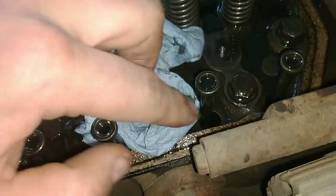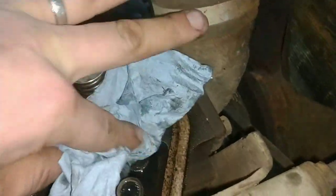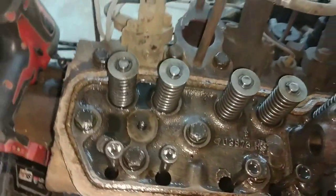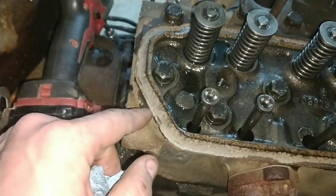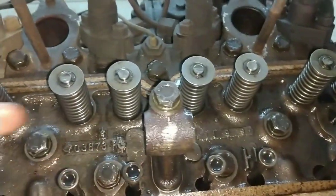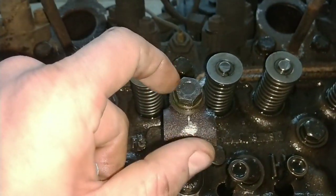I'm not going to replace any of the gaskets — I'll just put it back together. This valve cover gasket is still plenty pliable, it's only five years old, so I think it'll seal fine. I did have to temporarily reinstall the shafts with the studs to make sure it was going to be straight, because there's no alignment on it. I just couldn't believe how loose they were. Anyways, I guess that's it for tonight.